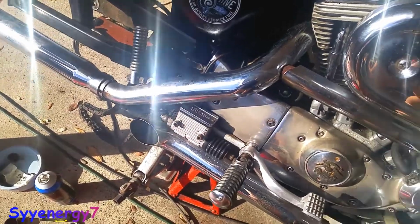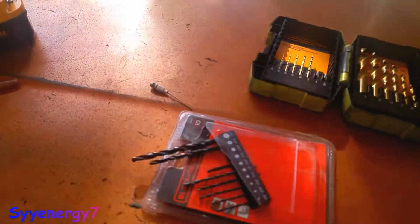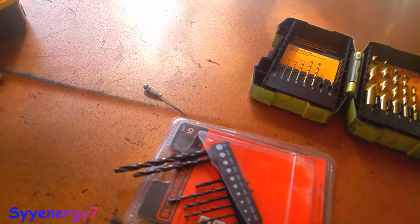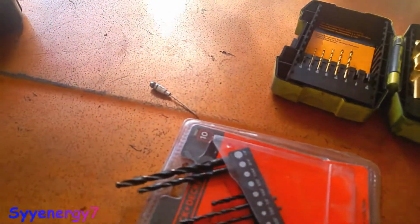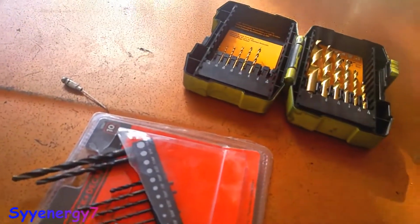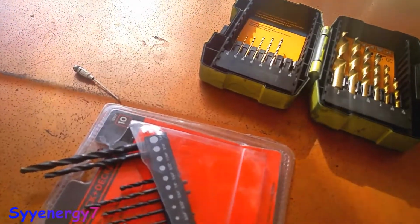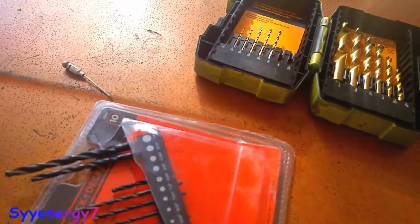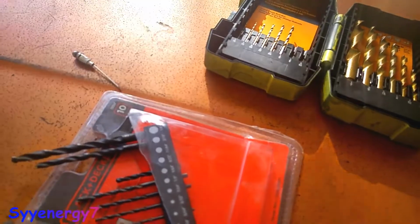The real reason these bearings and bushings go bad, it's not like there's a lot of wear on them from movement. It's called contamination, and not so much dirt and dust, but water, because water makes the bearings corrode and rust. That's really 90% of it right there. Even dirt, you're not going to get major gritty dirt like gravel. You might get a little fine dust, but if there's a lot of grease, that still isn't going to be much of a problem. It's water.